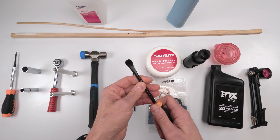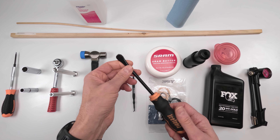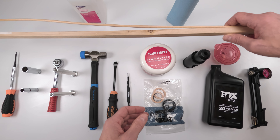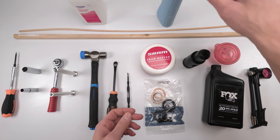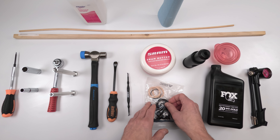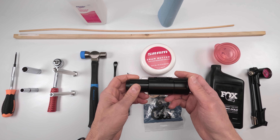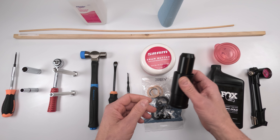To remove the wipers, use plastic-coated tire irons - I've never had one chip a fork boot since I started using them. You'll need a pick to remove the seal from inside. To clean the inside of the boots, dowels, alcohol, and paper towels are used. To install new wipers, a specific wiper installation tool is strongly recommended - without it you risk damaging the wiper springs, which serve an important purpose.